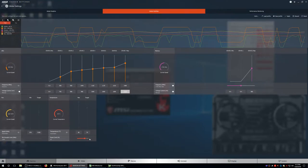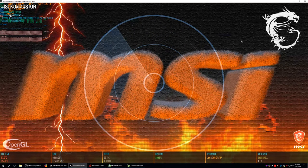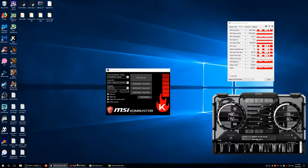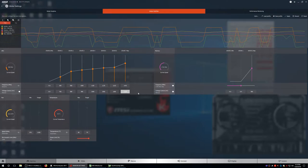I like this program, this is really easy. Let's try 1120 mV — run test. No artifacts right away. Oh, there's one. So obviously not stable. I'd say maybe we can get around 1470 MHz — that was my highest when I did it by eye at 1130 mV. I'd run that program for an hour on those settings.